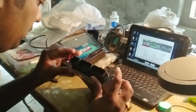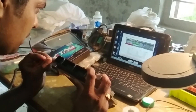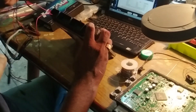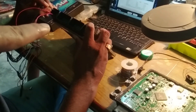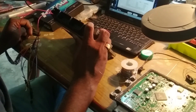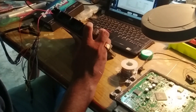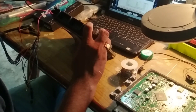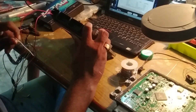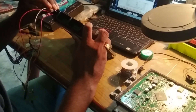When the engine starts, there is a fault of ECM. These are special pins connected to the programming pin: pin 1D, which is red color, which is 12V positive; pin 3G, which is black color, which is ground; pin 4A, which is white color, which is CAN high; pin 3A, which is green color, which is CAN low. The wire soldered on the boot is gray color with alligator clip.